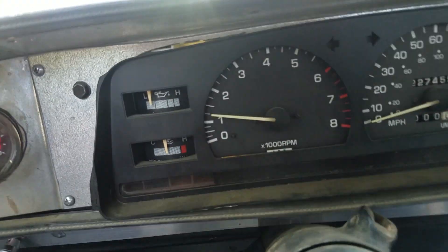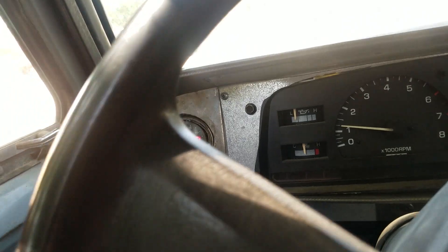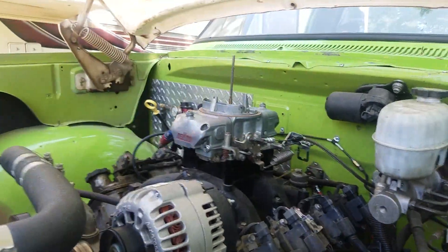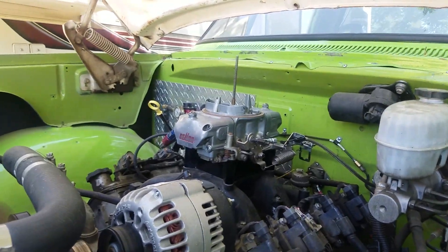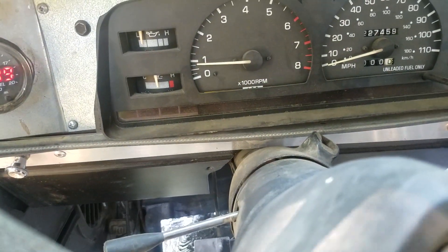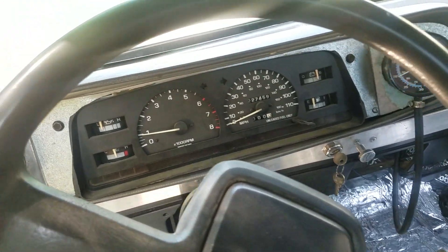Back home, my idle is a little high — around 1200 RPM, and the idle AFR is anywhere from 12.5 to 13. I need to bring the throttle down to 900–1000 RPM and lean it out a bit. After adjustment, I've got my idle pretty much where I want it — sitting in the low 13s, which is a happy medium, hovering around 800 to 900 RPM. Throttle response is still pretty good. That pretty much does it for today — Nightwrencher out.